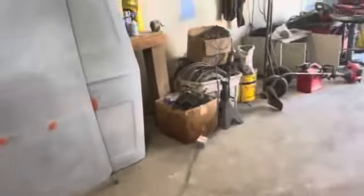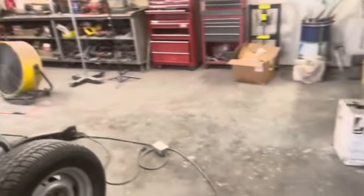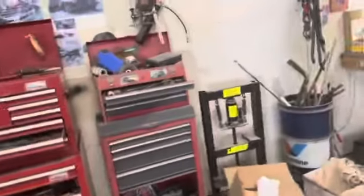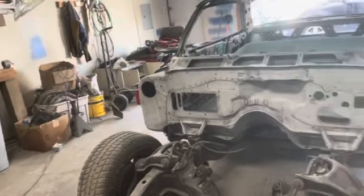And then the underside of the hood I have primered. I'm just going to hit it, hand sand it all with some 180, and shoot the underside of that hood before we shoot the top of it. Just kind of have those done and out of the way. So I'm trying to do the parts that I can do that I'm comfortable doing myself. And we'll get some paint on the firewall like we talked about earlier in the video.